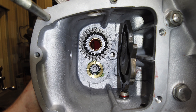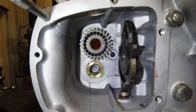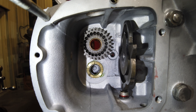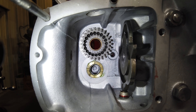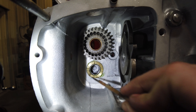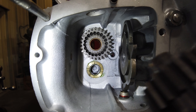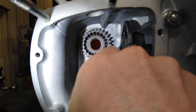So now we've got fourth gear and we've also got the sprocket on and tightened down. The next step is you're going to put your lay shaft in. I like to fill that needle bearing with some assembly lube. Then your cleaned up, inspected lay shaft will get installed. Make sure that the lay shaft bushing is properly installed — there's a little pin right here to locate that bushing, so make sure that gets installed properly. Now you can put in your freshly cleaned and ready-to-go lay shaft. Make sure it spins and everything looks good.